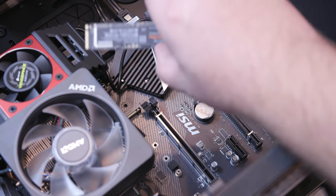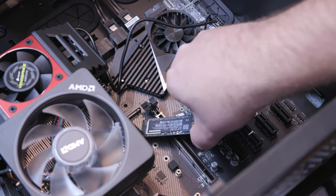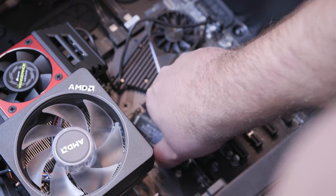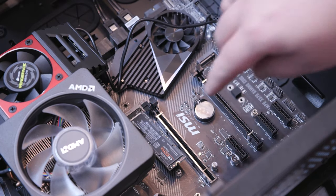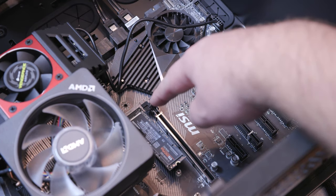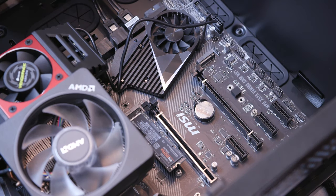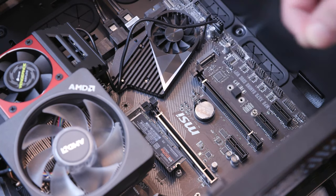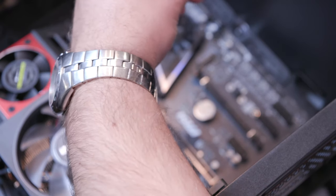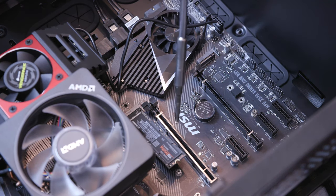And next we'll take our M.2 card. I can see the slot. So we're gonna go down here, carefully. Installs at a 30-degree angle. I don't know if you can see it from here, but it's actually angled right now. Currently it's like spring loaded, right? So then you're going to take one of those itty bitty tiny screws that came in your motherboard kit. It is super small. I mean, you probably barely even see this, but anyways, it's down there. And so we're going to basically come on down here and get this thing installed. So I have my magnetic screwdriver here, and we'll go ahead and bring this down.